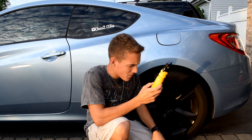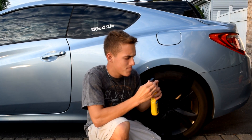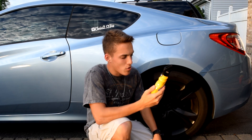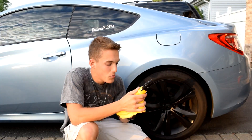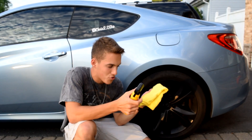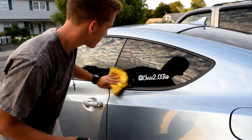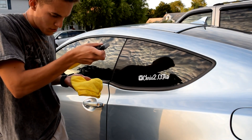The first thing I'm going to do is turn it to the spray position. Second step — point away from face. Then apply Rain-X to a small folded dry cloth and wipe onto exterior glass using a firm circular overlapping motion. Allow it to dry until a slight haze appears.